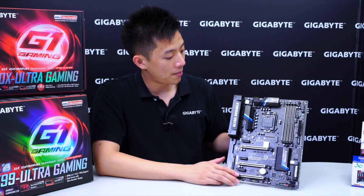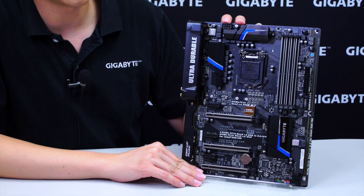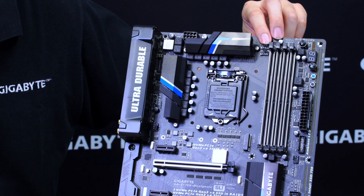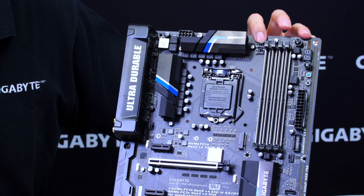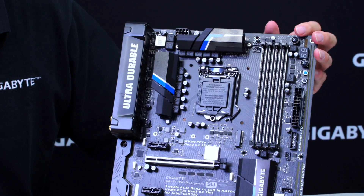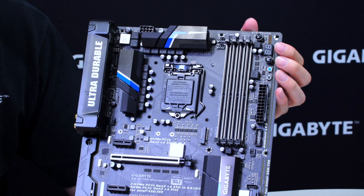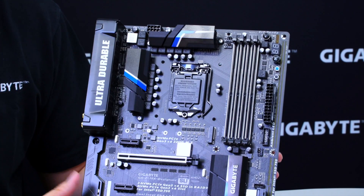Let's take a closer look at the board. Overall the board is all black with some blue — very neutral colors. At the top you can see the CPU power connector, a 2x4, which provides enough power for overclocking. Right here are multiple fan pin headers — one for your CPU fan and a CPU optional header for a pump. There's also a power button for quick debugging outside the chassis, and a debug LED that provides error codes if your memory isn't seated properly or your CPU isn't installed correctly.